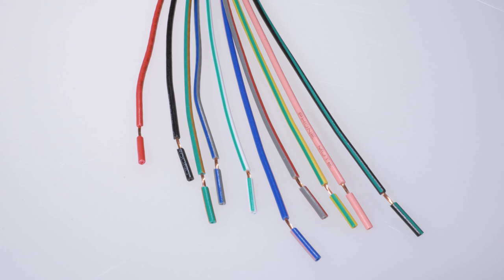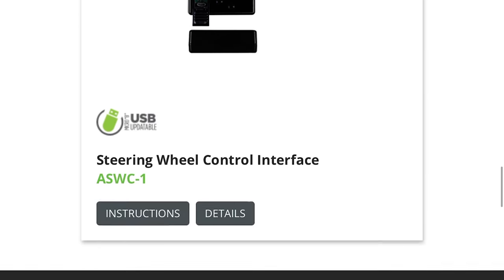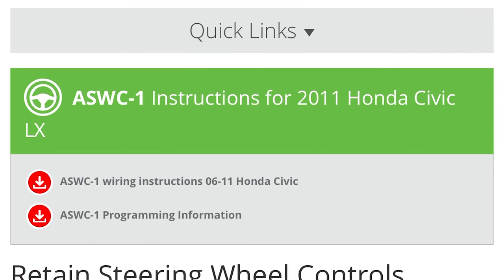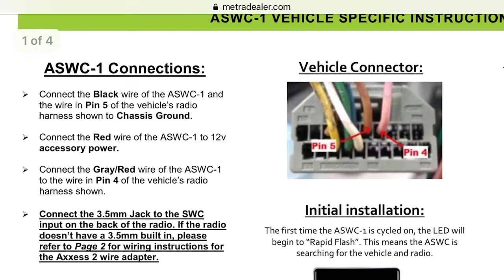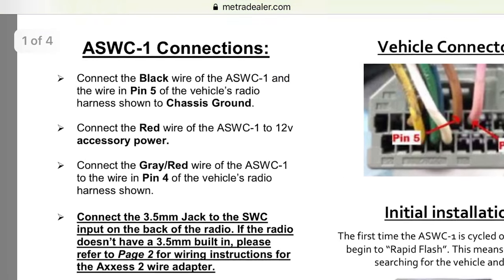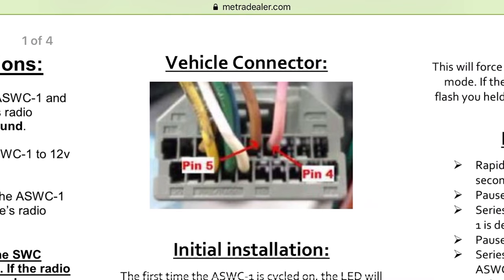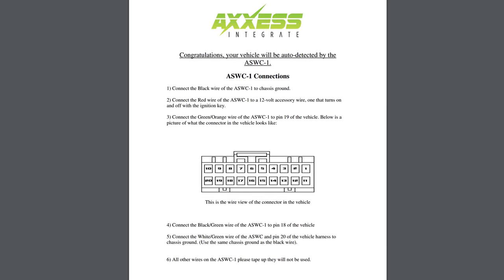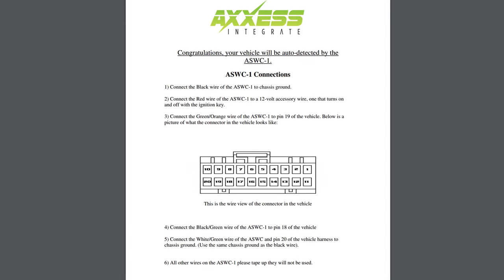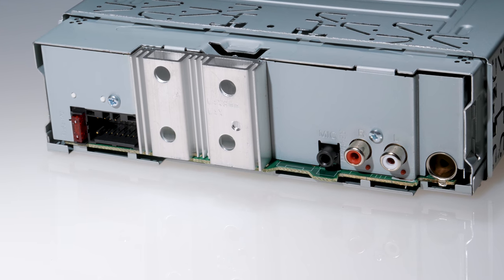In order to control your new radio, you'll have to tap a specific pin or series of pins on the vehicle's harness with specific wires from the 12-pin ASWC harness. To find out which wires to tap for your vehicle, go to accessinterfaces.com, enter your make, model, and year, and the site will provide the pins you need to tap and which wires from the ASWC interface harness to use. For example, it may say tap pin 18 on the vehicle harness with the green and white wire from the ASWC.